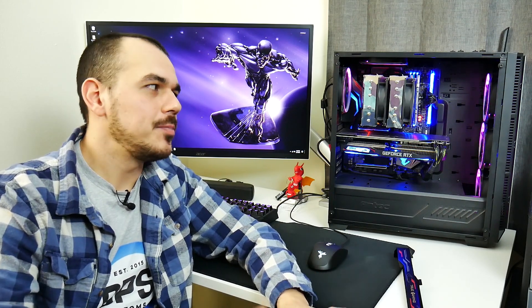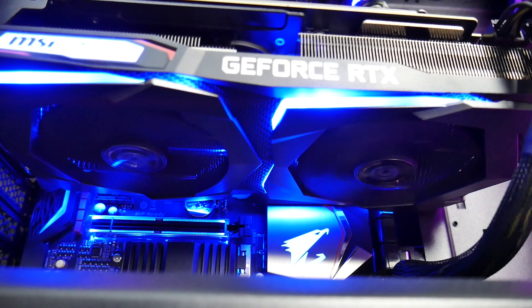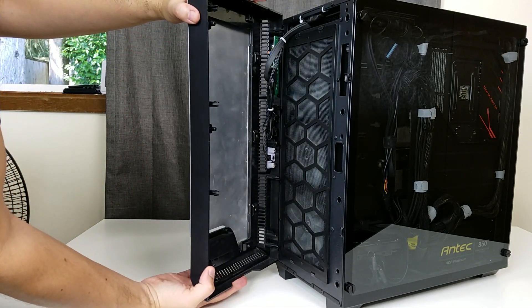As far as noise is concerned, between the Antec fans I'm using plus the fans on this TwinFrozr heatsink, this card remains fairly inaudible up to about 1600 RPM fan speed, at which point it does become a bit noticeable. But it's never anything super jarring unless you slam it to 100% fan speed. Even without allowing the fans to ramp up past maybe 65% or so, this GPU never got hotter than 72°C — and that's in an Antec P8, which is already a really enclosed case that's kind of starved for air.